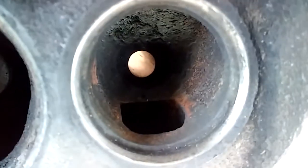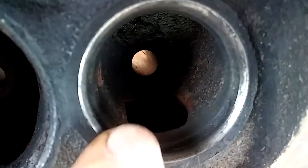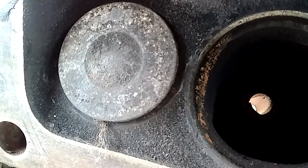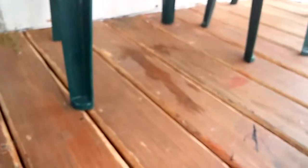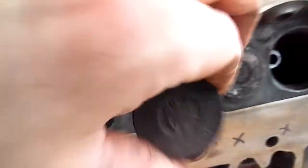This is a hardened seat right here. Now you can kind of see it. These seats you ain't got to worry about — see how the valve sits up like it's supposed to. They still wear but they don't wear out as bad as that. These are hardened seats, so these you ain't got to worry about. That's a lot of your difference right there.